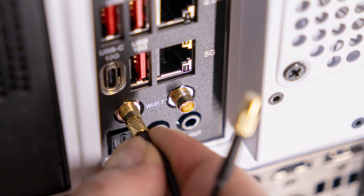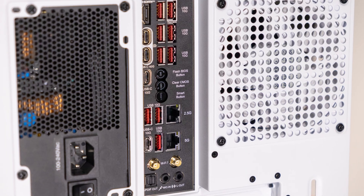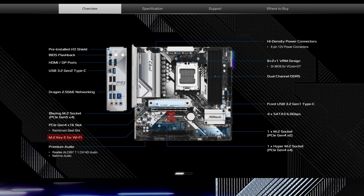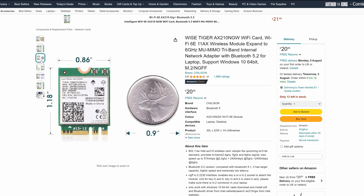But in general, I think using your motherboard's built-in Wi-Fi is going to be better than using a Wi-Fi USB adapter. I used to rely on these and they're completely rubbish. There are good ones, but in my opinion they're less reliable than the motherboard's built-in Wi-Fi. The third option you have available is that some motherboards actually have an M.2 Wi-Fi slot, and instead of having a PCI Express card, you can actually use an M.2 Wi-Fi card.